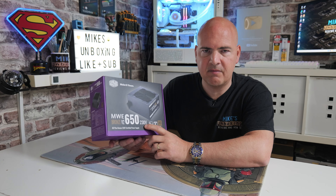This specific version is the 230-volt model. There are other options for European and US customers, though the part number will change. I have noticed on this particular UK version the main capacitor is only an 85°C unit made by CapXcon, which isn't great. If you go for the European version you'll generally get Elite capacitors, which are better — not premium Japanese ones, but for a budget brand they're the pick of the crop. That said, Cooler Master have put their money where their mouth is by offering that five-year warranty.